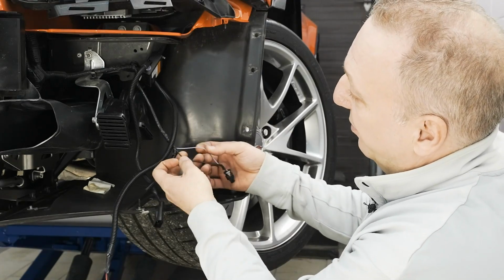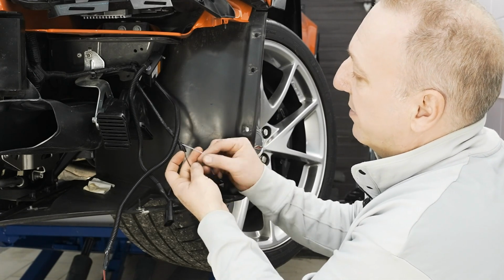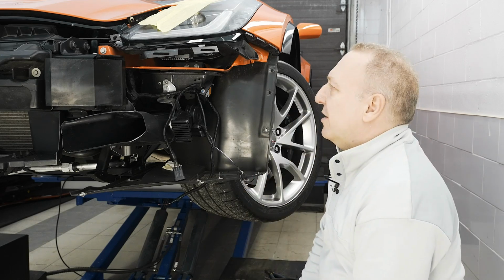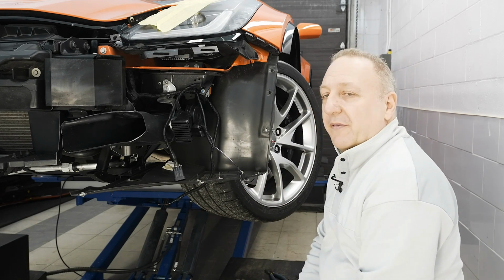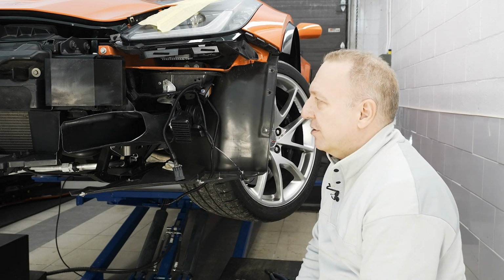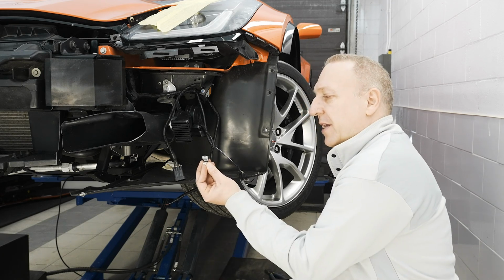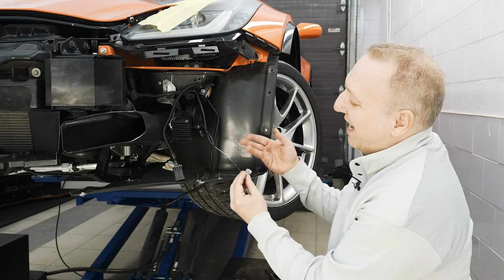And now we have our two wire looms, and these are basically the ground and the power supply. The battery's been disconnected because obviously we're working on the electrical system of the car, but there is no power to the circuit. So rest assured, there's no issue, double insurance. And we're using a T-tap system. Basically, we're not trimming any wires, we'll be tapping into it.